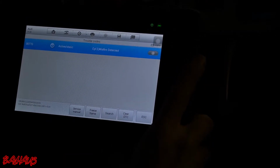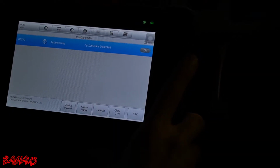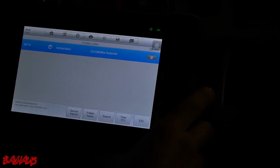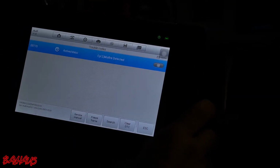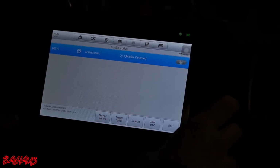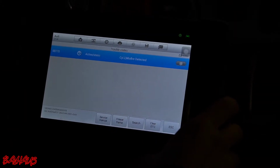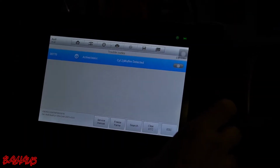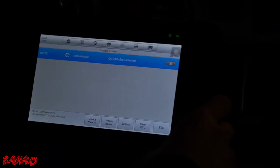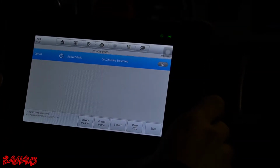So carbon clean for sure, and we're gonna move around some fuel injectors to try to move that misfire to probably cylinder 1 again. Put everything back together, come back in the car, and properly diag where this misfire is. Instead of just throwing parts at it, we're going to actually figure out what's wrong before we do anything. We do have all the injectors on hand, just so when we do get the diagnosis, if it does end up being an injector, we are ready for it.